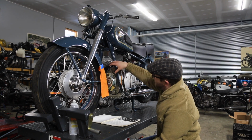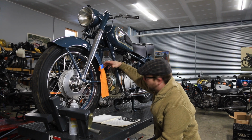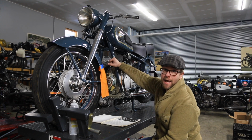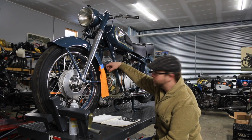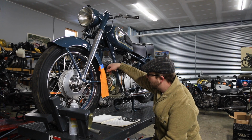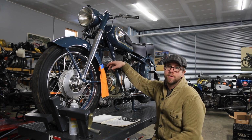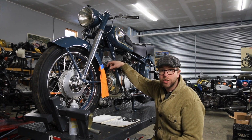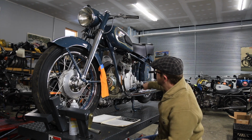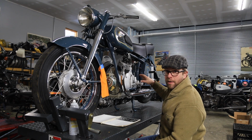And I have to take off the entire charging system and ignition system, which is actually an aftermarket electronic ignition that was installed that I had to go through and statically time with very poor instructions. So that was super fun. It uses a BMW /2 style ignition advance unit. It's almost identical to what's found on an earlier /2 from BMW, same time period-ish on there. So I'll give a close-up of exactly what's going on.